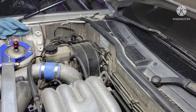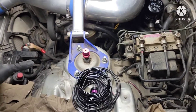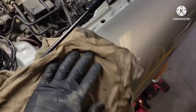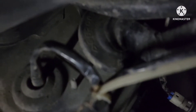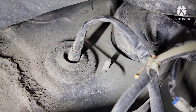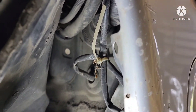I was thinking of going through the vacuum booster over there, but I don't want to drill holes in the firewall. So I'm thinking of running it on the left side right here. Just noticed my battery is in the trunk, so it's gonna follow the battery wire. It goes into that hole right there. I took off the wheel on this side and peeled off the liner, and then it's gonna come up on the top of the engine bay right there, then into that big flat wire loom — and then that goes into the cab. I'm just gonna run it this way, across the dash, then right side of the driver all the way to the A-pillar. That's my idea — no drilling and no cutting wires.